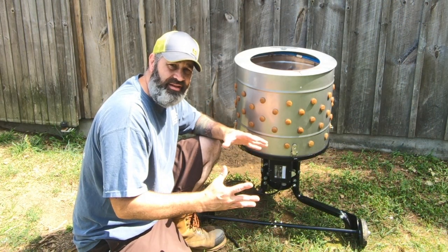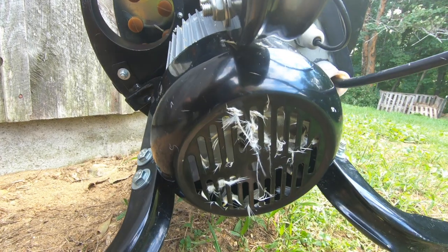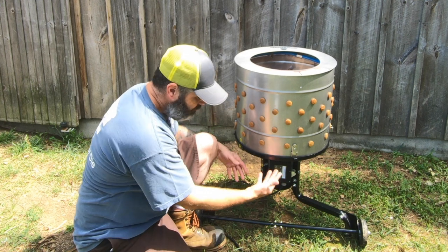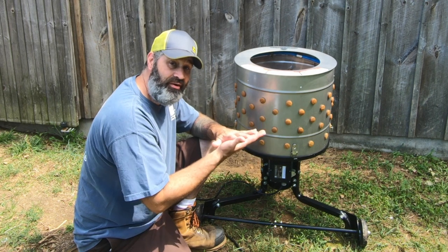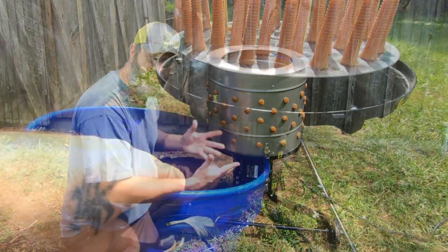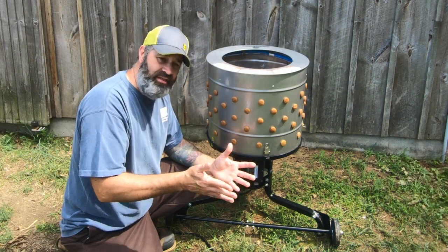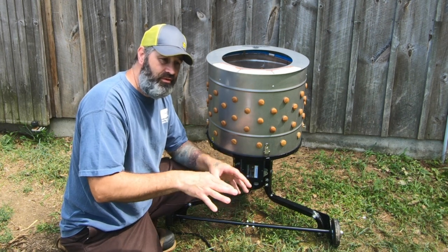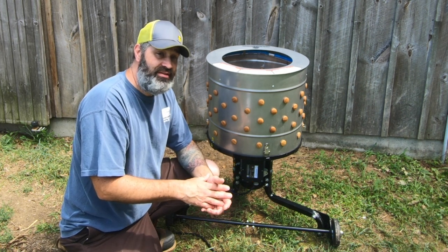Another area of concern is the vent and fan system, which is located at the very bottom of the unit. The problem is all of the water and feathers pour out of the unit right into that fan and vent system, which clogs the fan from spinning and also clogs the vent so no air can get through to cool the motor. Even though you put a bucket underneath to catch the feathers and water, I brought this design flaw up to a woman at Yardbird and suggested they put a rubber flap of some kind to protect the fan — she agreed with me, but said it was something I could do on my own.